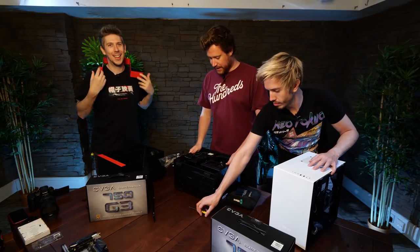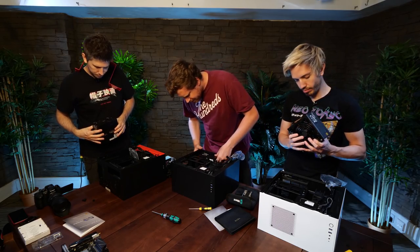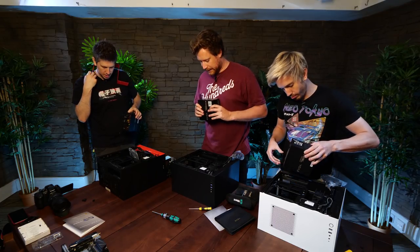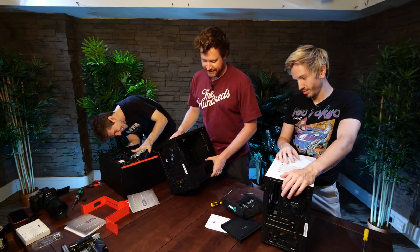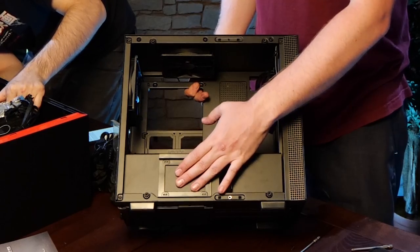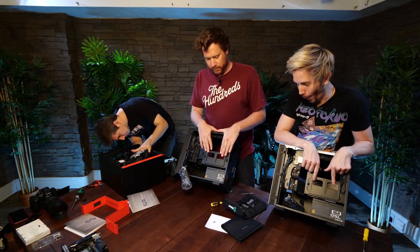To put the PSU in, just lay the case on its front. You can see at the bottom here we've got the gap that we slide the PSU into. The fan question — I thought it would point downwards towards the mesh. I usually install them pointing downwards. There's a little mesh at the bottom — I guess that's what it's for. It depends if it's a push or a pull fan. In terms of SSDs, we're going to be using a solid state drive as well as a cheaper library drive option. You've got one port at the front, and on the back you've actually got two potential mounting points for more SSDs.